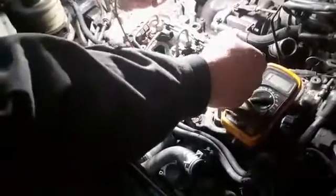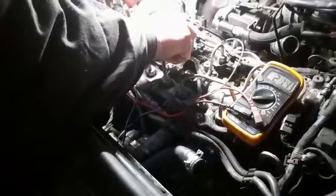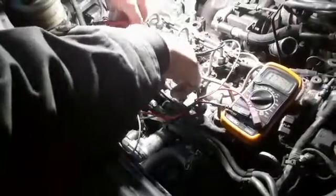It just means that this is sending resistance back and shorting out the ignition system, and that's why your engine's stopping. So not only test the wires, test to the body as well, because that will give you the problem if there is a problem. Also check when it's hot and when it's cold to make sure you haven't got one breaking down when it's hot.